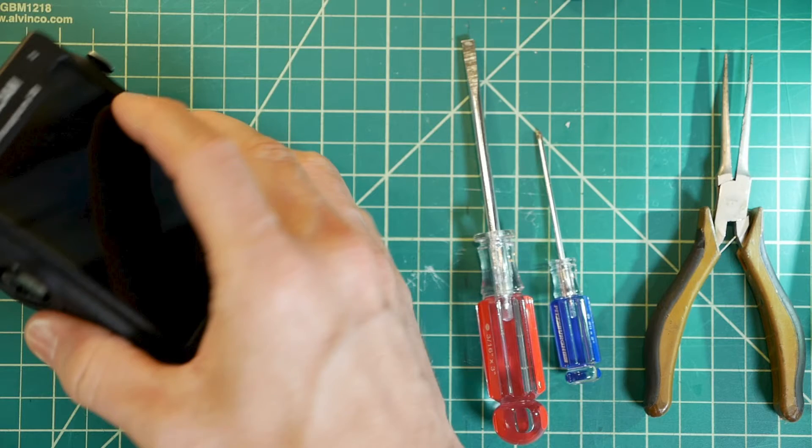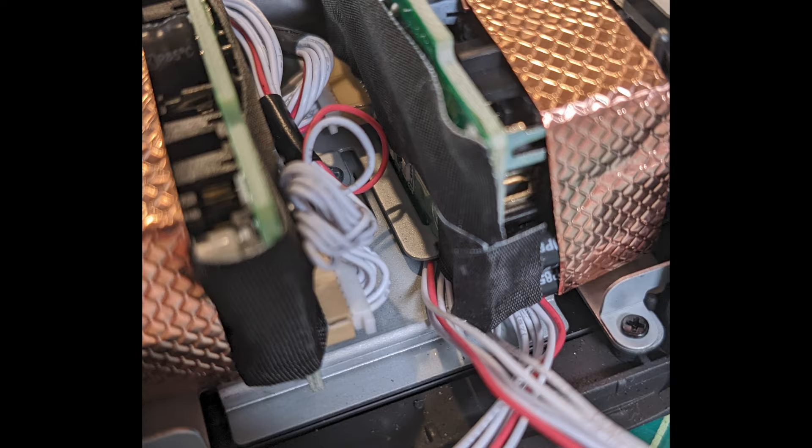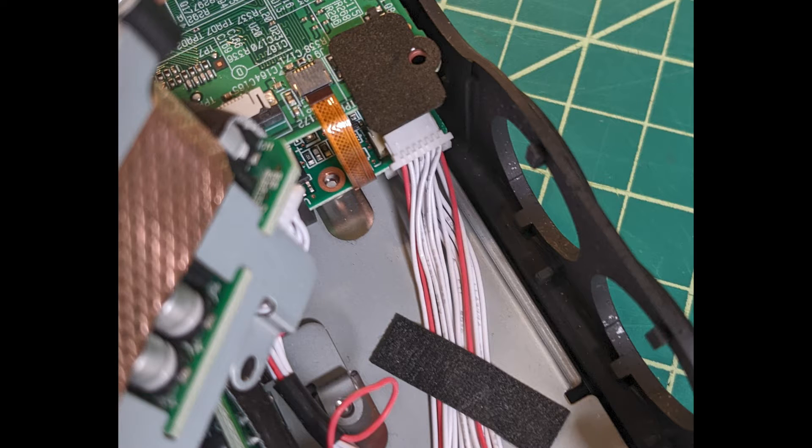I have to know where the missing chips are. After reassembling it, it bothered me too much, so I took it apart again. And I found a bad design when removing this cable. It's routed underneath the XLR inputs 3 and 4, unlike the other one which goes between the XLR inputs. You can see it's crushed here by the XLR module.